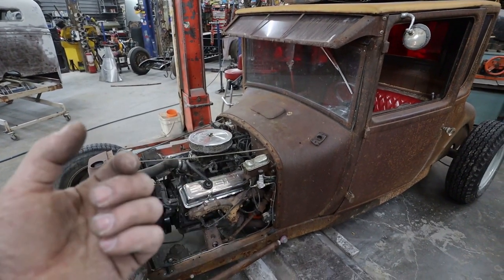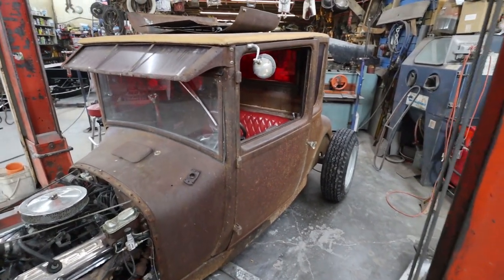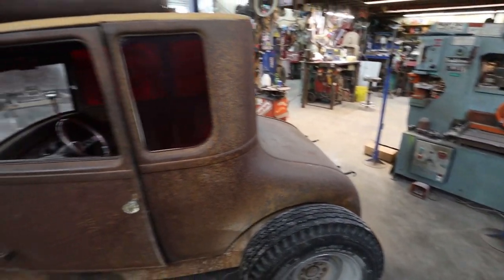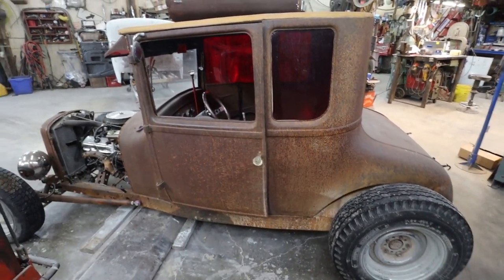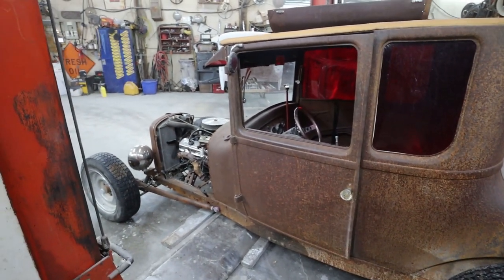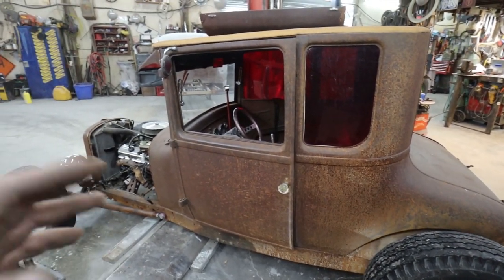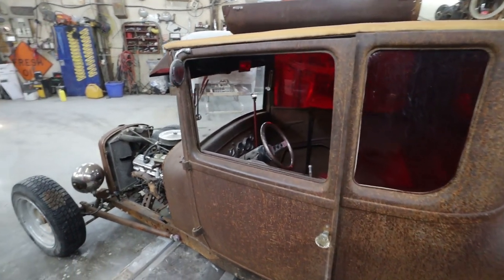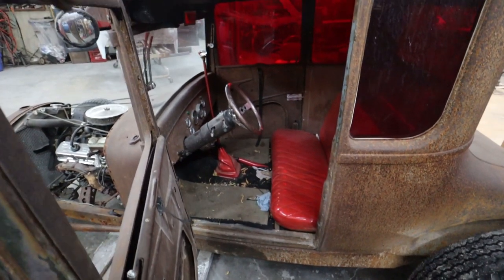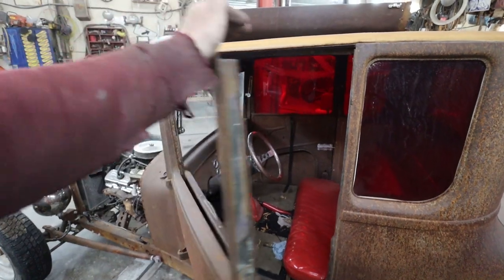I'm going to take a milder stall, take that out, and I might change the gears too at some point. I got 373s, but this thing just zings down the road. With that combo, I think this thing for some reason spins like 3,500, 3,600 RPM, so I want to bring that back down, because it doesn't look like it, but this is a super, super comfortable car. I could probably jump in here and drive to BC without a complaint whatsoever.